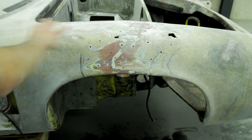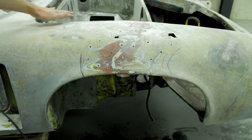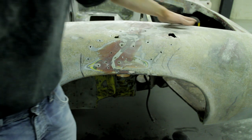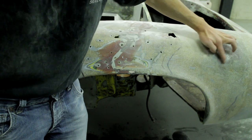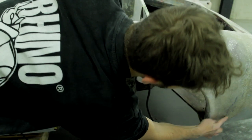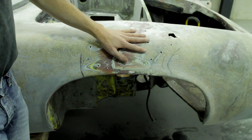I've done the first round of fiberglass repairs. The hole for the hinge is filled, this crack has been repaired but there's a slightly low spot, this repair has been completed but there's a low spot here, so I need to add a couple more layers. The crack here has been repaired.